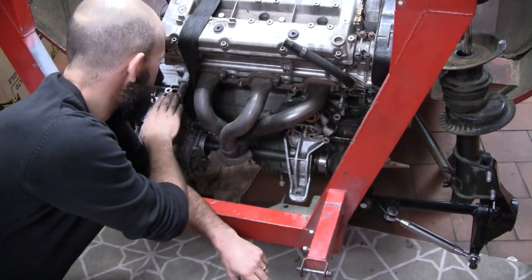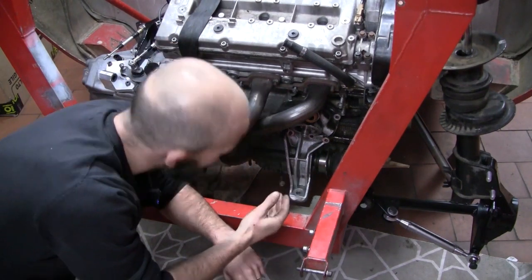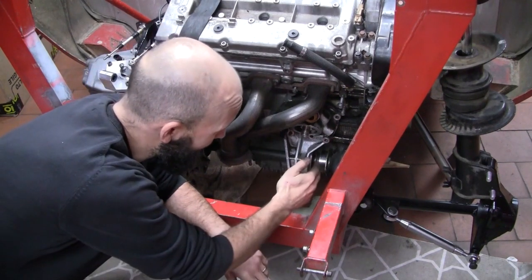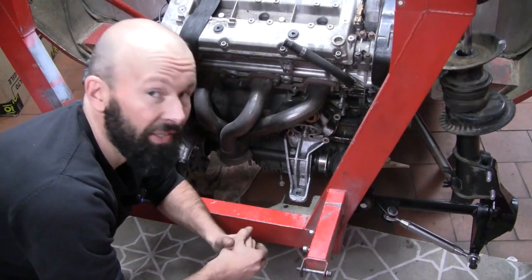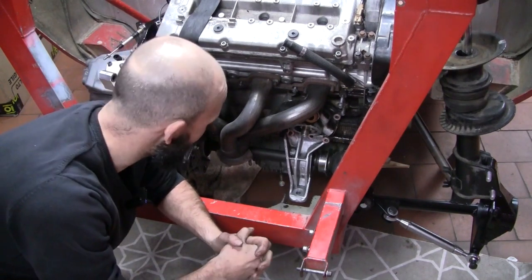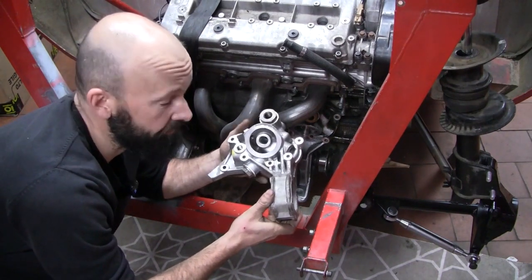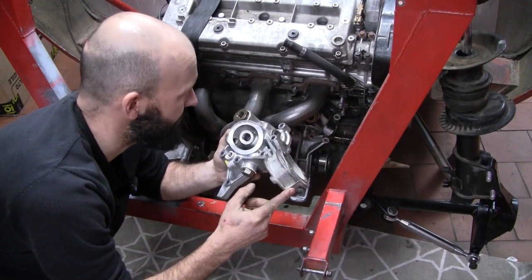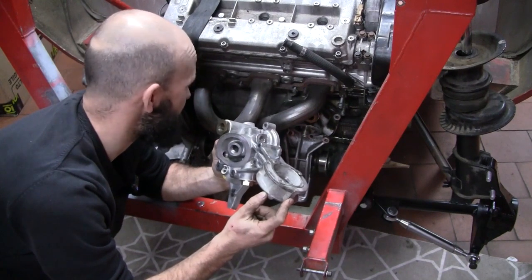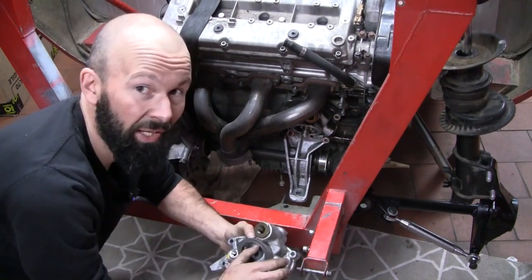Then I got the six-speed box and that drive shaft came with it. I went to install it and soon realized that the bearing sits quite a way out from where the housing is. No worries, I thought — I'll just find the correct engine mount and bearing housing to suit that drive shaft. But this one doesn't have an engine mount. Turns out the later model V6s with the six-speed box never used an engine mount in that location — they just had a secondary gearbox mount over here.